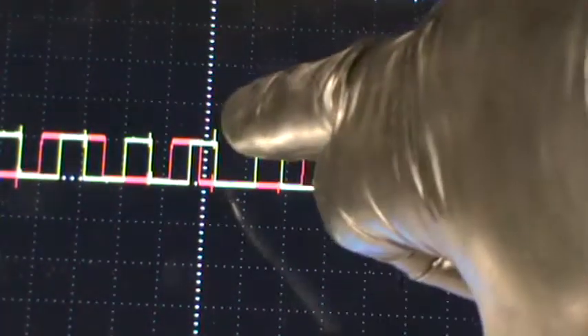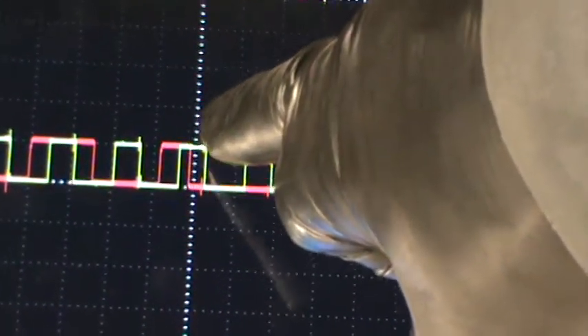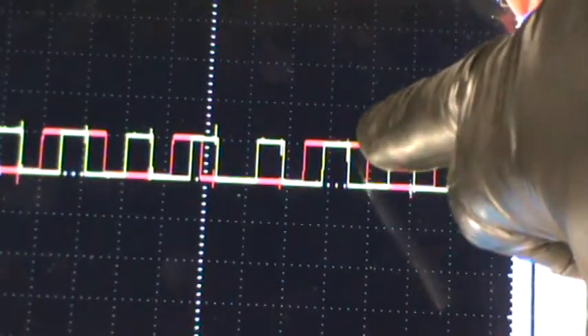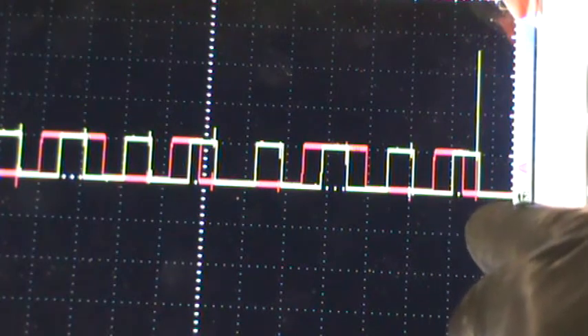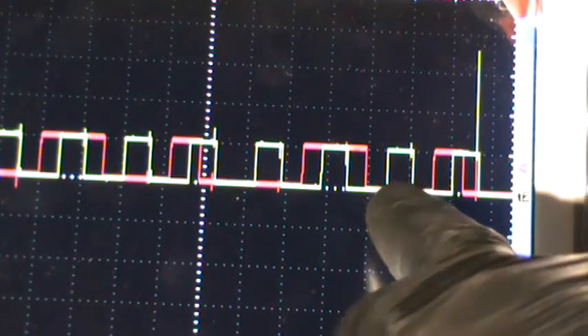Just for the simple fact that the yellow starts right exactly in the middle of the red. And not only that, this is right exactly in the middle of the red also. Just looking at that, you can see that the timing is correct. There are more characteristics on the camshaft — this full yellow trace is perfectly in between those two. It's the same as that one, perfectly in between those two. So this is the same as that, but this is not the same as that, if you notice.